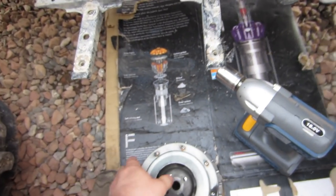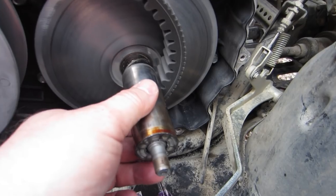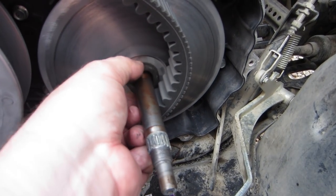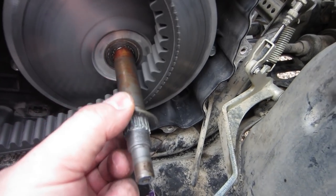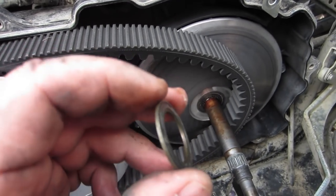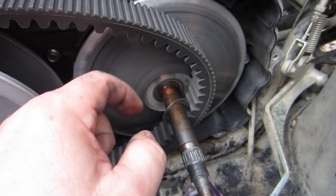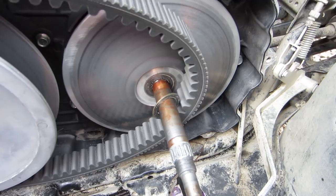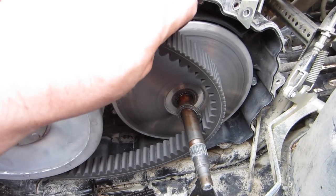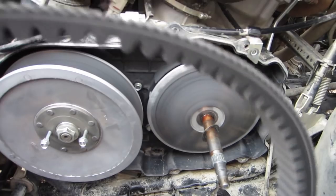While I'm at it, I'll just show you the mods I have done to the Grizzly — well nothing really. The only one I have is right here: two washers — a one millimeter and a half millimeter shim. It just goes on there to keep your sheaves apart a little bit more so your belt sits lower, gives you a lower ratio. You lose a little bit of top speed but not a lot. It helps the bottom end quite a bit. So now this belt should be able to come off.